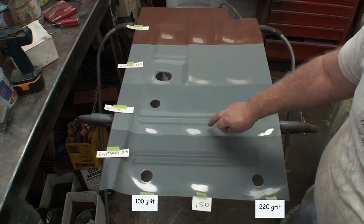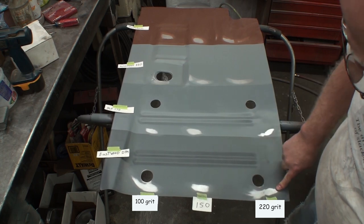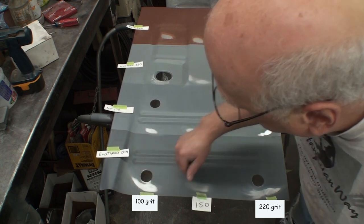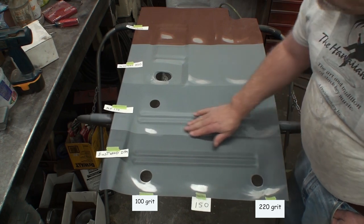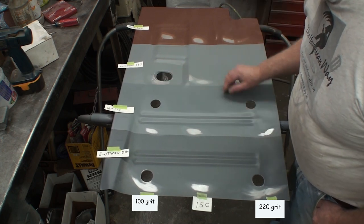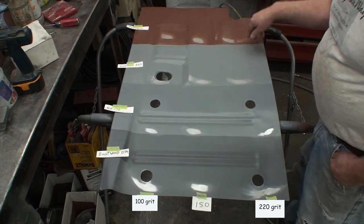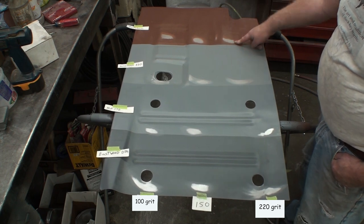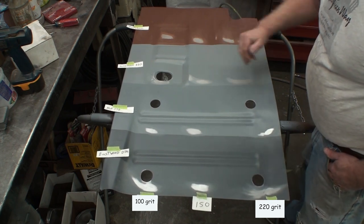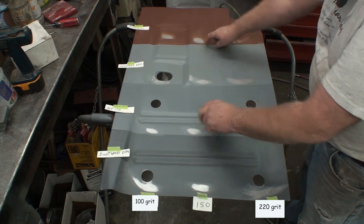So the MP170, that is at the top, I think. Next in line is the Eastwood. It actually took a little bit to get it off, and you can see how it feathers really nice. Well, I'll show you in the close-ups. So this feathered really good. And you get over here, and it blew off pretty quick, and it's showing those same chips I had on Betsy. And the Rust-Oleum took as much effort to sand off as the Eastwood DTM, and it feathers perfectly. Actually, of all the products, it feathers as good as the MP170.